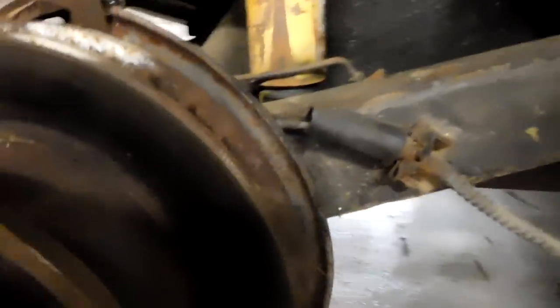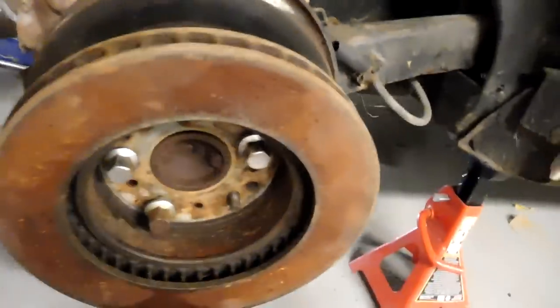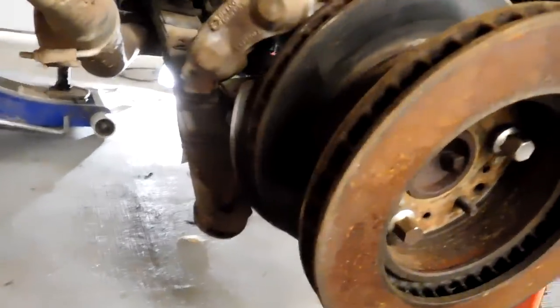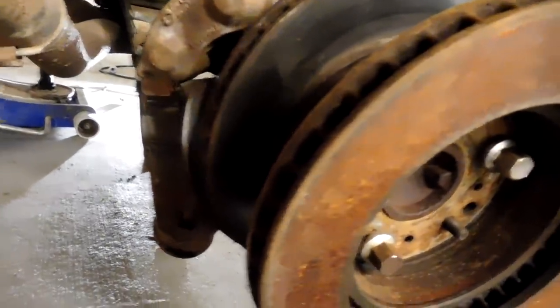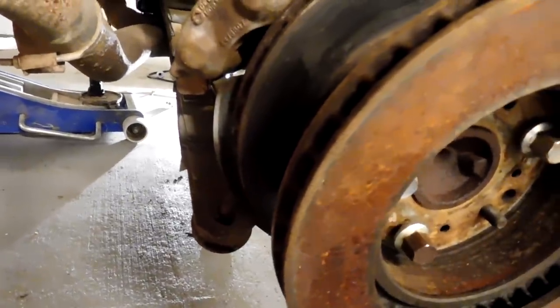The main thing you want to do is watch in here. You have your half shaft that connects to your flange right here, which then connects to the spindle — that is where the movement is that you want to watch for. I'm going to show you the passenger side first because it's not as bad as the driver's side, but it gives you an idea of the range of movement you can expect on these rear suspensions.